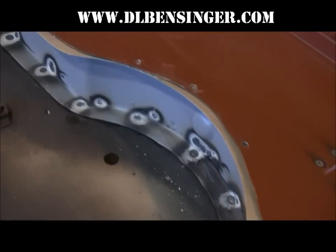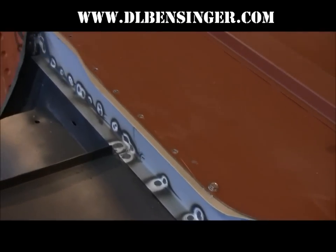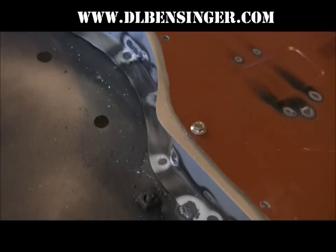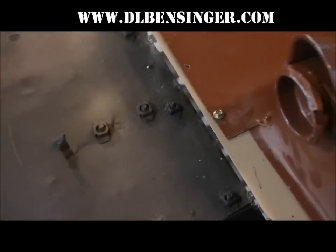In different areas where it's hard to get a clamp or where we just simply don't have enough clamps, we're going ahead and using things like those sheet metal screws. They're only going to be here temporarily. We will be taking them out as we do our welding.